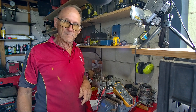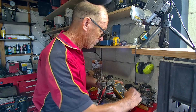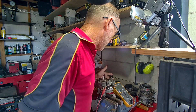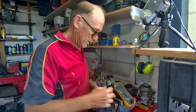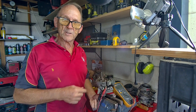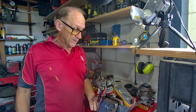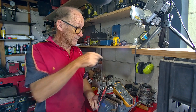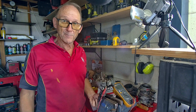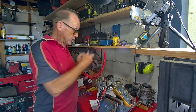In here I'm pulsing on the voltmeter, so as far as I'm concerned the pickup coil is working fine. You can also do a resistance check - there is a resistance value for it. Switching over to ohms, it should be somewhere around 1.1 - and we're reading 1.12, so beautiful, the resistance is fine. Don't touch these two wires when spinning anything, because they produce an alternating voltage and you may get a kick.